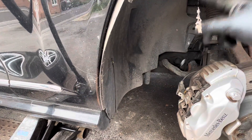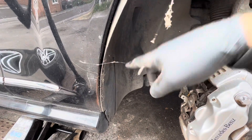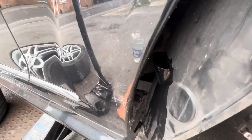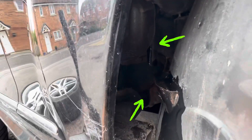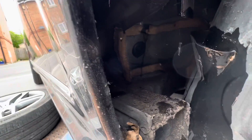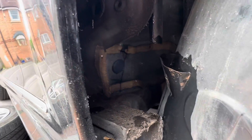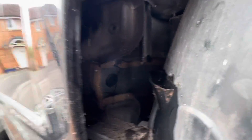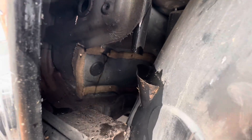With the bolts out — 10mm and a couple of 8mm and a 10mm in the bottom — I'll show you where the water collects and drains out through this hole. See that — the collector there, the exit, and then there's the pipe above. It backs up in there and then also runs back down these chassis legs, which again are sealed, but if there's a grommet the water will find its way through the weakest point. So not only do we need to clean this out, but we need to make sure these pipes are all clear as well.